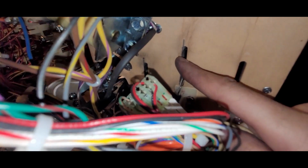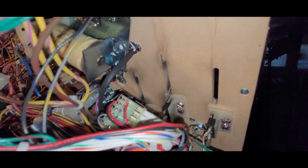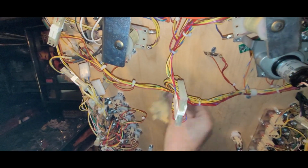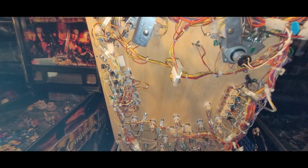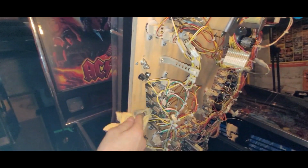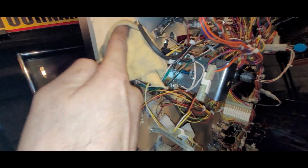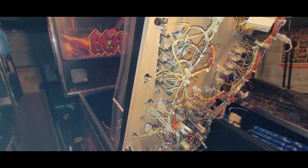And right inside, there's some more carbon dust, but I don't think I'm going to be going through every single switch slot, but definitely trying to get rid of as much of that dust as I can, because I'm going to be cleaning the playfield and changing the rubbers, and I want to track as little of that dust back onto the playfield as possible. So everywhere I go, every mech I do, try and reduce the total carbon dust content.